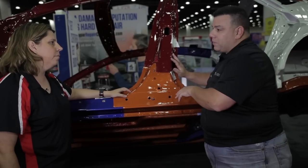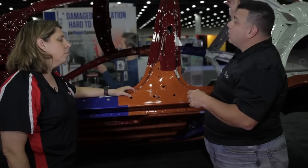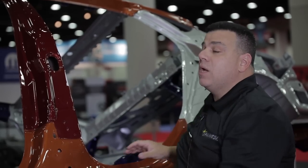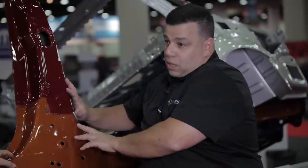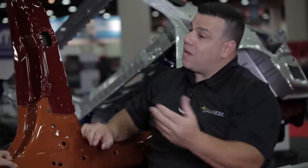I'm not giving exact Chrysler procedures — just a few different ones so everyone understands I'm not doing a Chrysler class here. Chrysler does require weld bonding in many cases. When you section an outer panel on the sail panel or rocker, they require full bonding with an insert. BMW does the same type of thing — they weld bond a lot of their panels together and do a lot of resistance welding. In the aftermarket field, BMW requires rivet bonding to put the car back together.